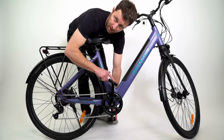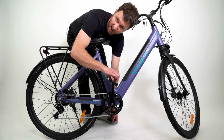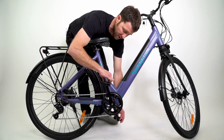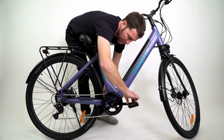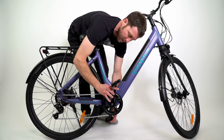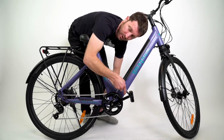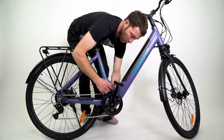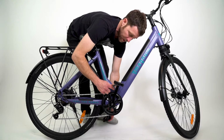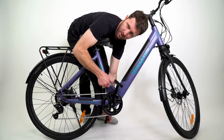You're almost ready to ride your new bike. First though, we need to tighten your pedals and do a couple other small finishing touches. Now the pedals, if you grab the spindles and back pedal the bike with the kickstand down, they should tighten. It helps to use a wrench on one side so that you can reach all the way. Once they feel pretty tight and you reach the point where they're all the way threaded, give them another good tug.